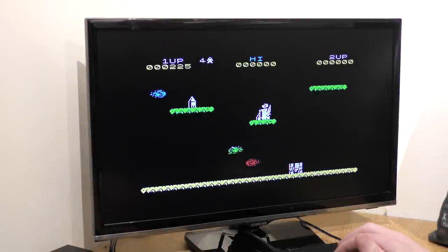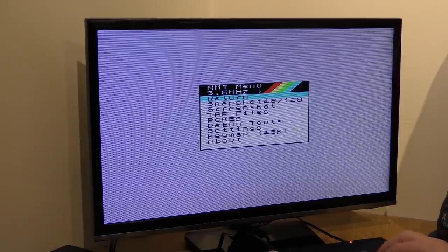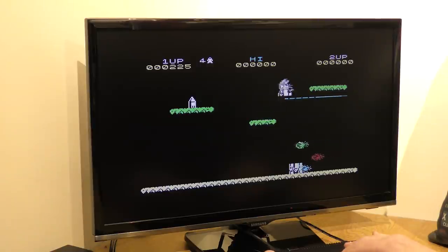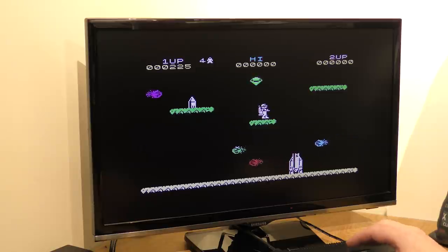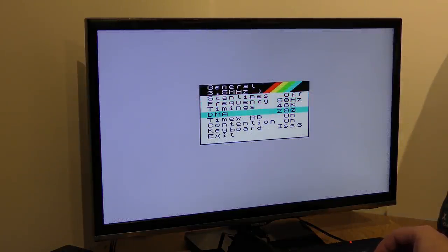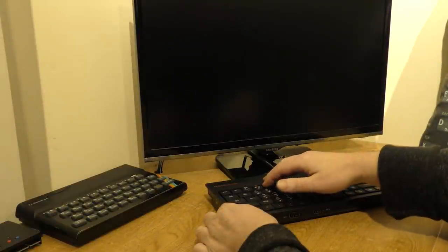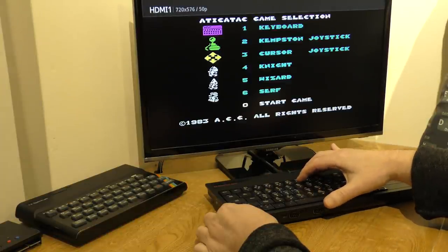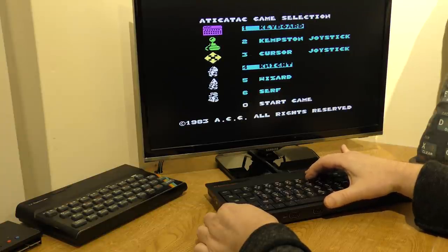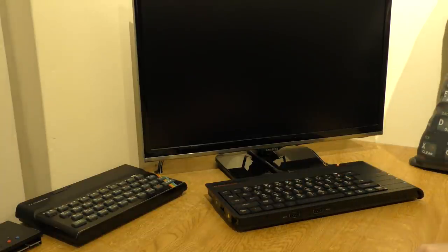Now for some more features. If you are playing a Spectrum game, you can press the NMI button to get a lot more options. From here you can add varying levels of scanline to give that retro feeling, change the sound options, change timings to try and get those pesky games to work, and you can also save snapshots in both 48k and 128k mode straight to the SD card. You can even enter pokes if you want to cheat. Another use for the NMI button is function keys. If you are not using an external keyboard, you hold down the NMI button and press the number key in relation to the function key, giving you various things as listed in the manual on page 21 — such as a hard reset, scan doubler or scan lines. If you have an accelerated Next, you can also swap the speeds using this method.